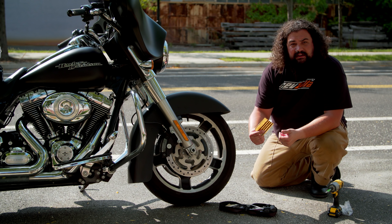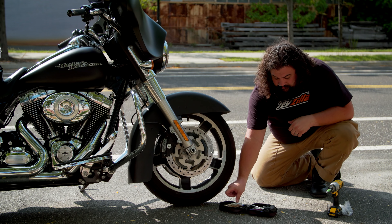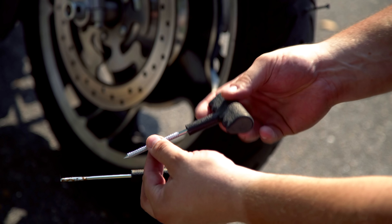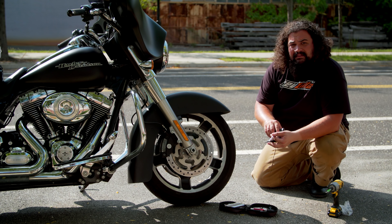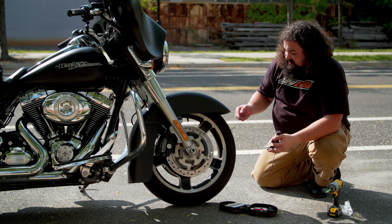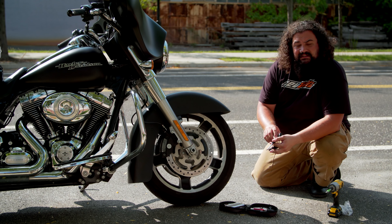Right here we have our string plugs themselves, made of a heavy rubberized coated string. These are actually what's going to hold the air inside of the tire. Now we have our tire repair tools. First we have a reaming tool — note it is heavily knurled down the shaft. We're going to thrust this inside the tire a couple of times, and those knurls are going to help knock the burrs off the steel cords running through the tire so they don't tear up our rubber string plug as we insert it.